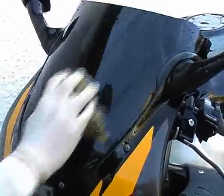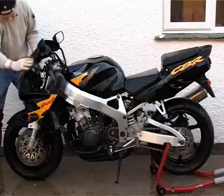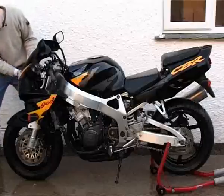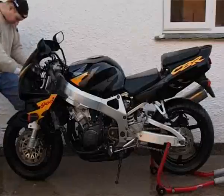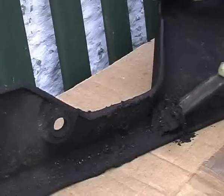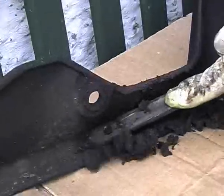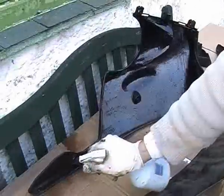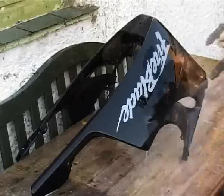Start on the cleanest bits and work your way down to the wheels. Don't be tempted to use your chamois on the mechanical parts — just leave them to dry out and keep your chamois oil free. Cleaning the parts you removed earlier is just the same story: gently scrape the big bits of crud off first, then WD-40 and a soft brush, oil-based degreaser and rinse, water-based degreaser and rinse, and chamois.